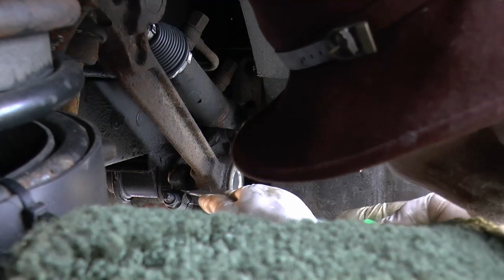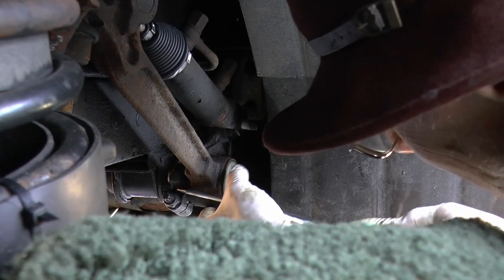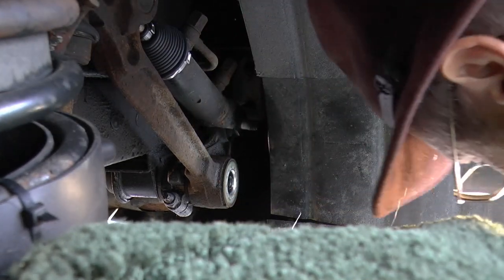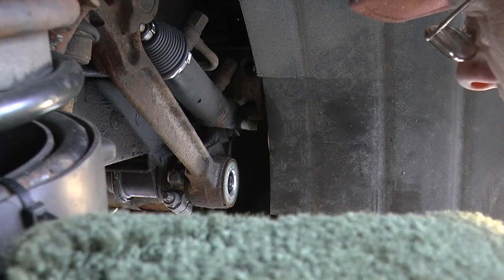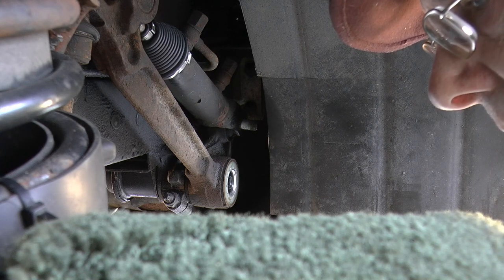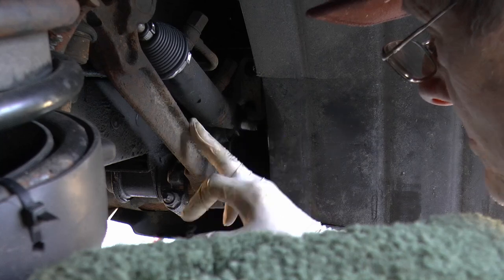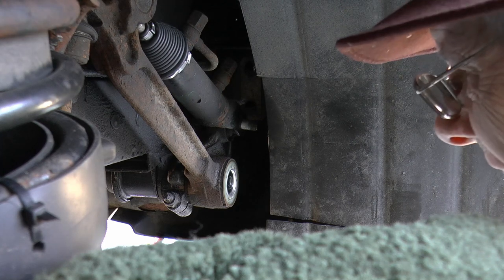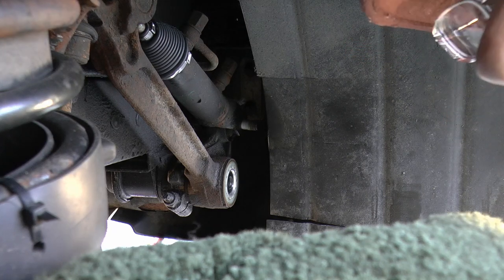I'm assuming it's still in the same place. Now what I'm thinking is it's jacked up on one wheel and there's no keyway system to lock this back in the same position on the shaft. So if I put it back wrong it's not going to work properly. She'll have to take the other wheel off — I'm going to take it off anyway to do the drop link.